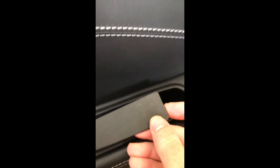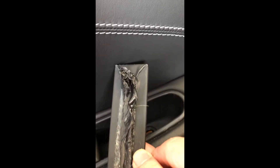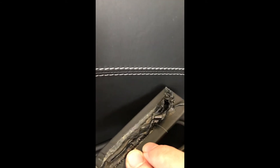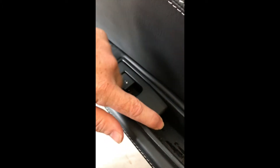Next, there's a leather cover down on the door handle. This piece fits like this, so you just get a tool up underneath there and pry it up — it's just held by butyl rubber, or 'monkey snot' as they call it. Then we need to pull that screw, and also remove the screw underneath the door handle. Once you get both screws out, that one and that one, it holds the door handle down.